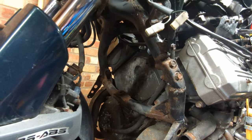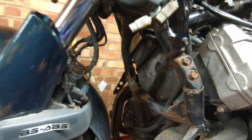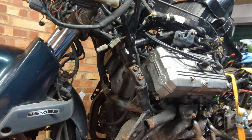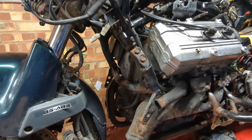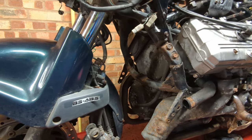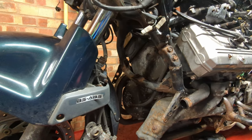This bike really did live by the sea. The crossbar is as crusty as everything else has been under here - lots of dust, rust and crud, but no serious structural rust. Got the screwdriver of truth on it. I think I need to step back and decide where we're going to go from here - possibly unbolting some exhaust and getting some of this lower frame away so we can tidy up a bit, then maybe a proper look at the timing belt once we've got that off.